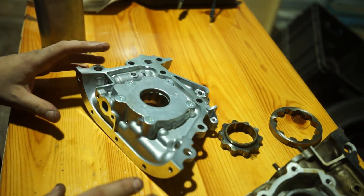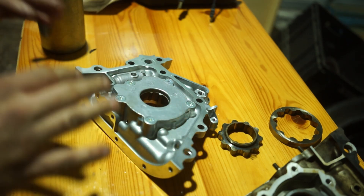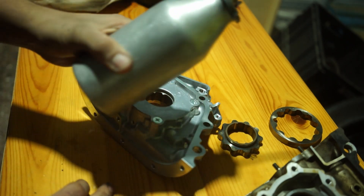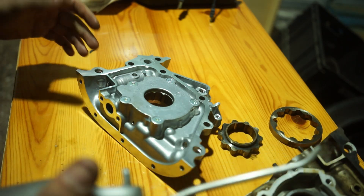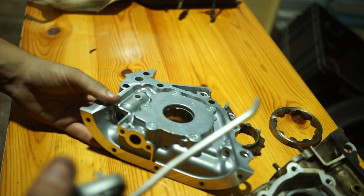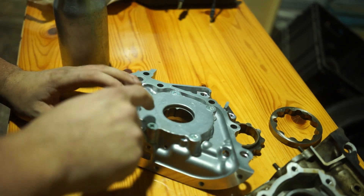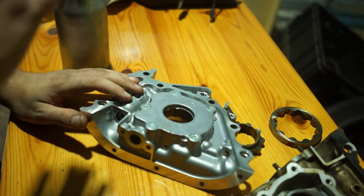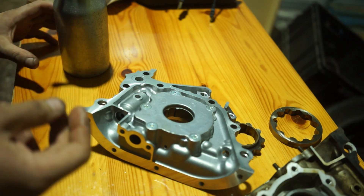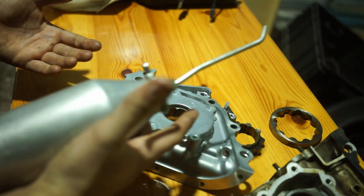You also want to prime your oil pump. Some people do that by packing it with grease, which is not recommended and you shouldn't do, because it's not going to build oil pressure. The proper way to prime it is to get some engine oil — you can use a relatively thick oil so it stays in the pump longer. If you plan to assemble the engine and it will sit for a few weeks or months, you can also put in some assembly lube — not grease or shock grease, just assembly lube, which is a thicker oil — and that will help the oil pump pull oil.